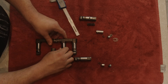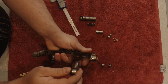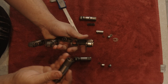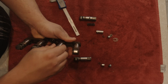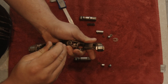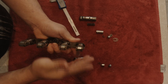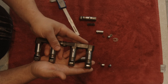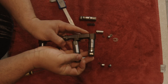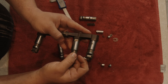That means if we were to switch these around, it's a very loose fit inside this yoke if a non-MDS lifter is fitted into an MDS lifter tray. Obviously this fits a lot better. If we were to mix this around, I can't even fit this lifter inside the lifter tray of the non-MDS lifter. So that's a basic reason why you can't just replace an MDS lifter into the tray of a non-MDS lifter, or a non-MDS lifter into the tray of the MDS lifter.